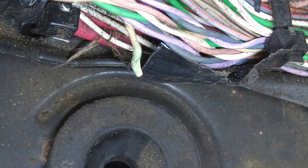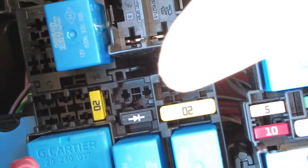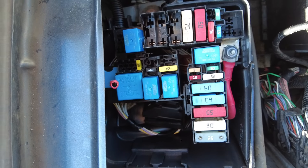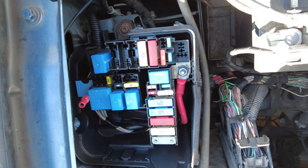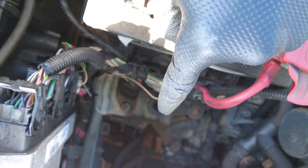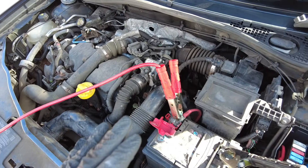We're going to get that repaired. The wiring diagram shows a green wire for the switched side, however we double-checked it and it's actually a cream wire that goes to the relay — so the wiring diagram is wrong. Let's get this repaired and get everything built back up.